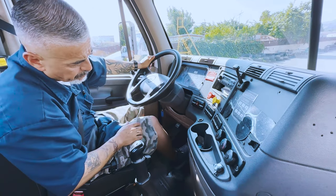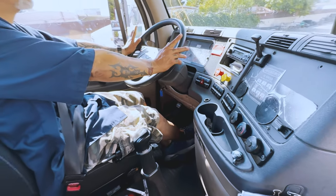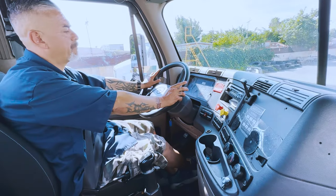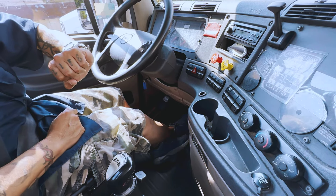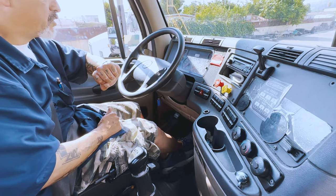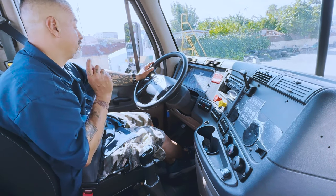Now I'm going to apply pressure to the service brake. Push all the way in, chuck your foot. Waiting for my pressure to stabilize. Once it stabilizes, give them a primary and secondary reading. My primary is at 97, secondary is at 97. I'm going to hold it for one minute and my minute begins now. Do not release that service brake for nothing. Once your minute's up, give them a second reading. My minute's up, my primary's at 97, my secondary's at 97. I lost no more than four PSIs in this minute. This is a good test.